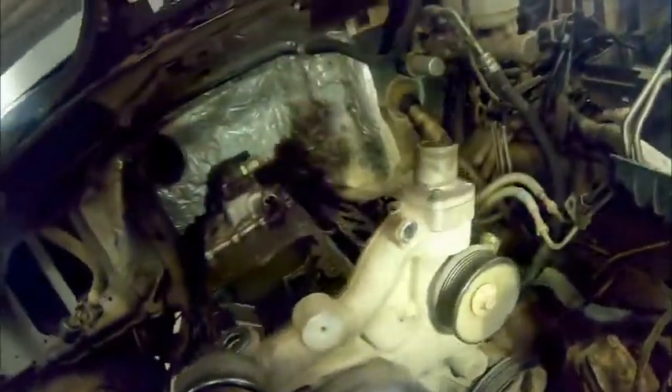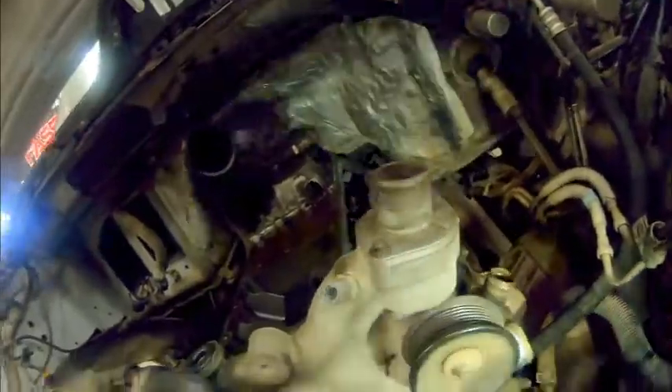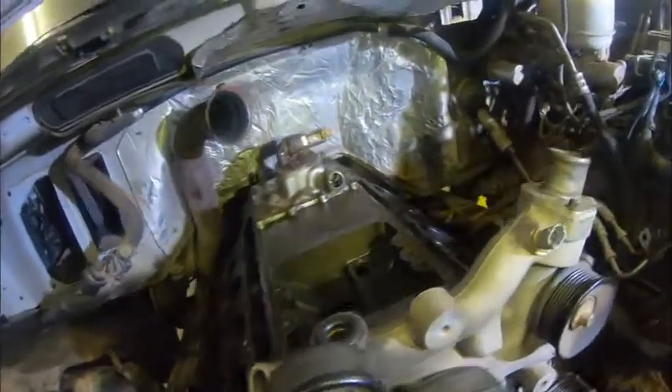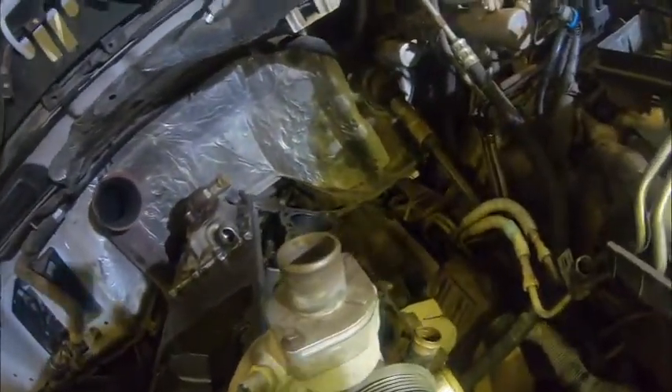As you can see the engine mounts are still mounted, and now the teardown is complete. We're going to walk you through how to pull your engine without pulling the cab. I always like to start with the flywheel-to-torque-converter bolts — I feel like that's the best way to get started. From underneath, there are two or three places you can get to these flywheel bolts. One option: pull the starter and you can get the flywheel bolts right there.